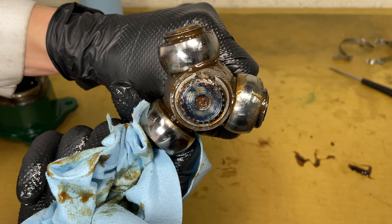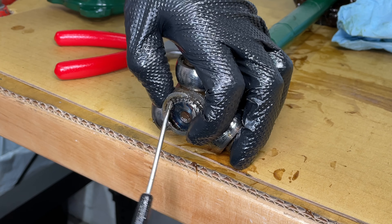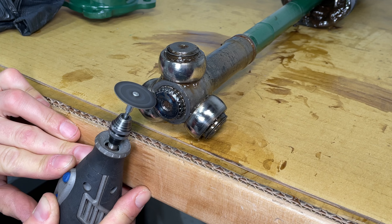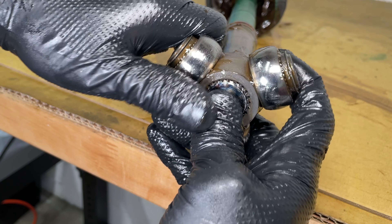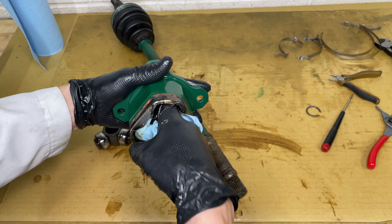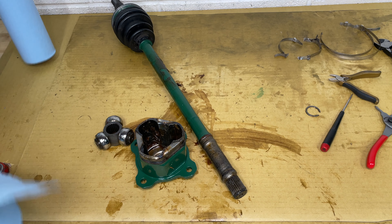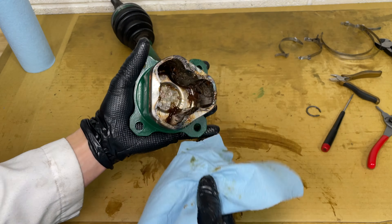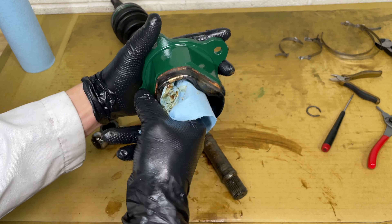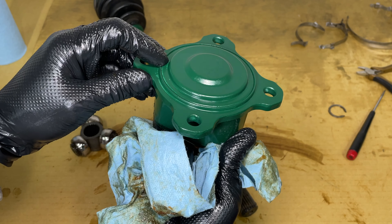The inner CV joint has these wheels with roller bearings inside and a C-clip that holds them onto the shaft. Use snap ring pliers and a small screwdriver to get the C-clip off. Mark the axle and the bearing carrier so you can put it back on the same way. I'm paranoid about a marker wiping off, so I'm cutting my marks with a Dremel. With some small marks cut into it, I can now slide the bearings off the shaft. I want to get as much of the old grease out as I can. This grease has not been contaminated — it's not actually bad because these CV boots have not been torn and no water or dirt has gotten in. I don't recommend using brake parts cleaner on this because once you contaminate the grease with solvent, then you've committed to cleaning 100% of it out. There's a little hidden spot under here — you could reach it by taking the cap off, but then it could get loose or lose its seal, so I won't be doing that.